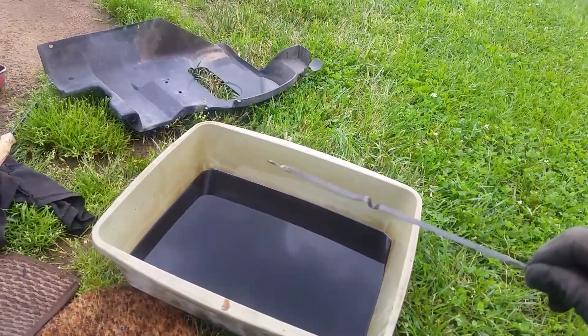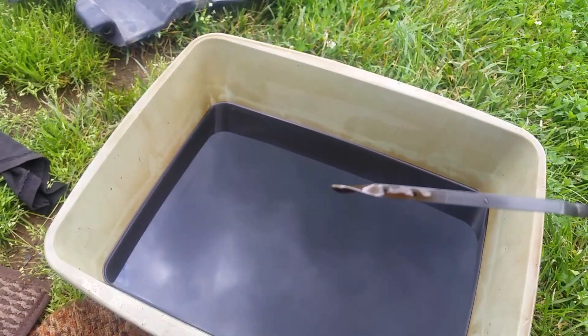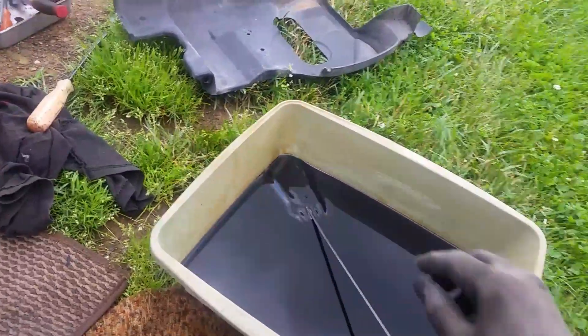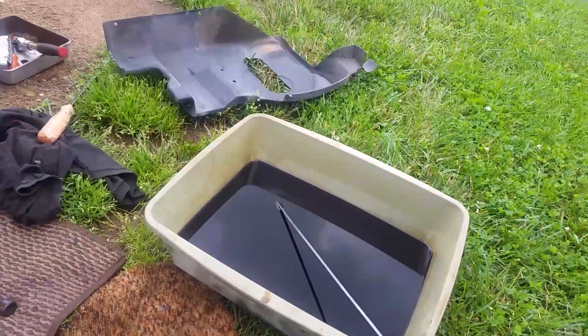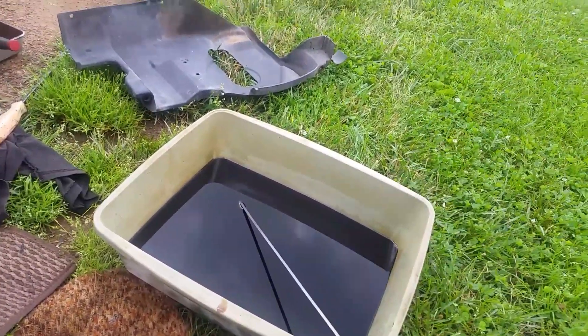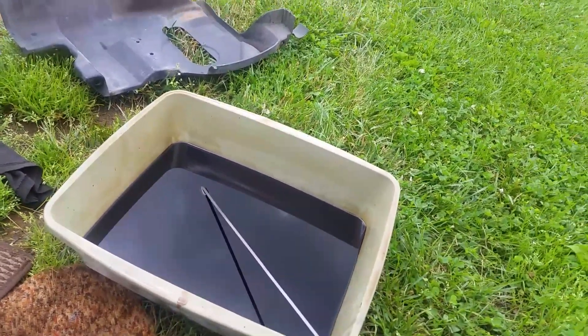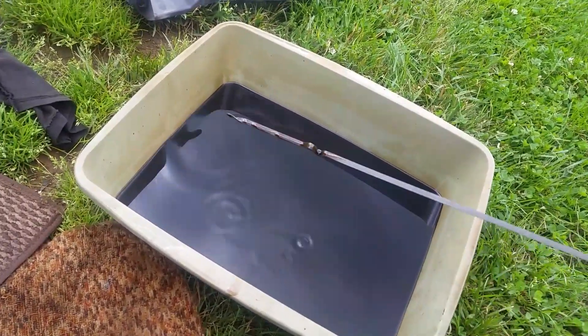Just knowing that somebody did try to take care of the transmission — they did change out the fluid. That is some pretty dark stuff. You'll see this a lot on older vehicles; you get over 100,000 miles and they don't change the fluid. It's typical — the clutch packs and seals inside start to degrade over time, and that's what this black is. It's very fine particle material, but you don't want to see any metal in your oil.